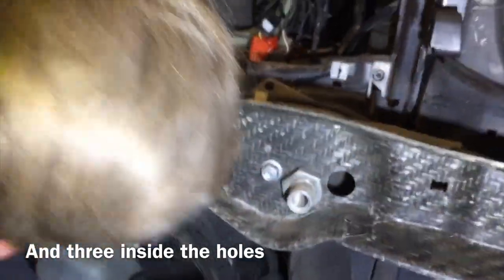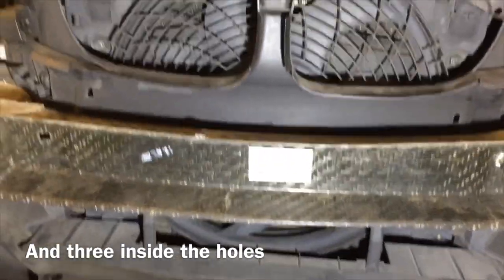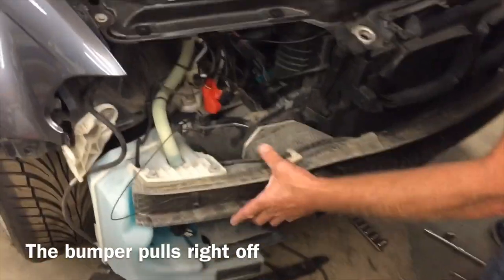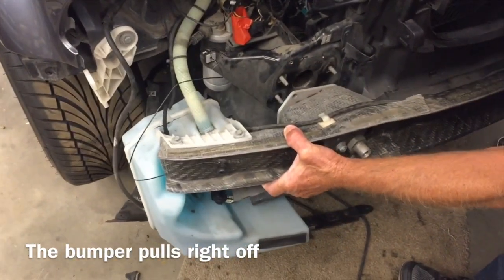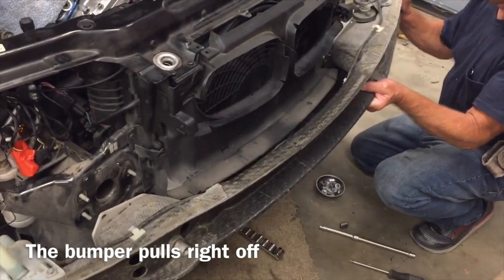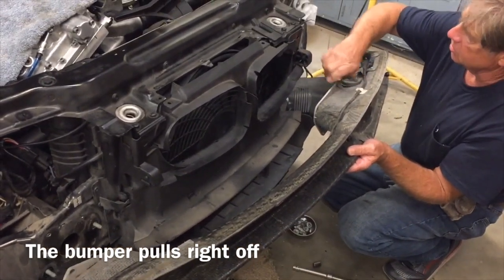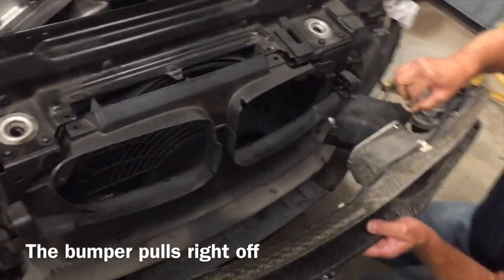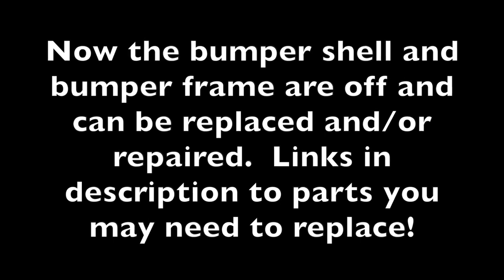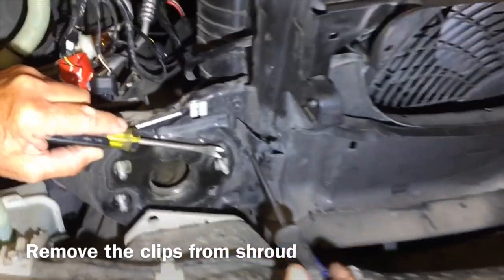I got those out — you've got three on each side. Take this thing off. I tied a wire on here because you have a water tank that's kind of heavy and I want to support that. We'll do the same thing on this side — just keep it safe. There's no need to pull this all the way off because all we're after is this area. With the bumper off more, you've got clearance.